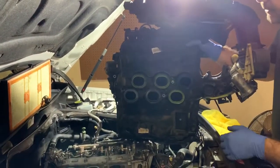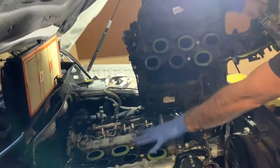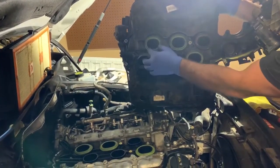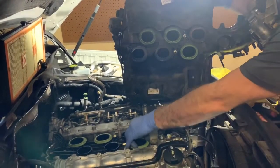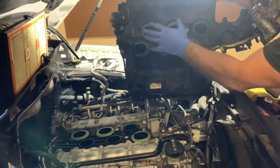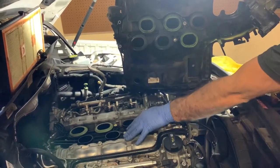Okay, so at this point what we have here is our intake manifold — it's going to be fitting right on top of here. Note: sometimes when you remove the intake manifold, some of these little gaskets here will remain fitted on the top, some on the bottom. My suggestion is to actually remove them from the top if they're loose. In this case, these are all pretty snug in there, so I'm not going to touch them.